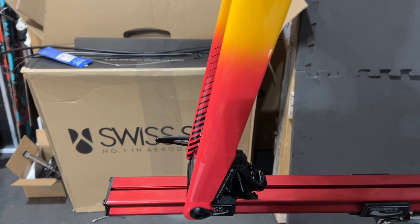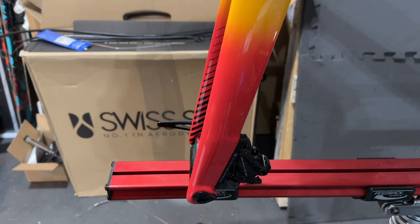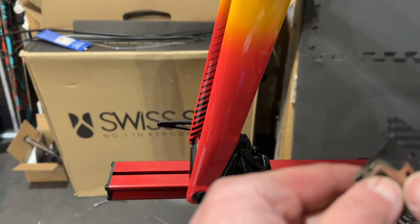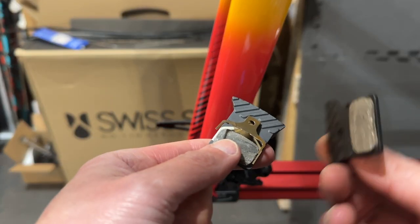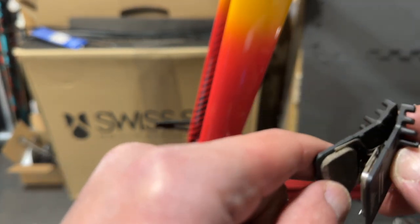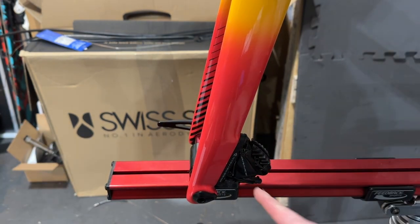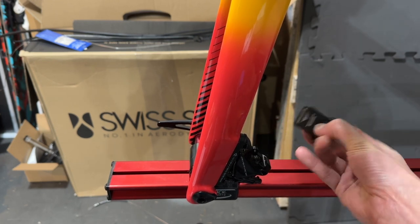So the first thing that I've done is removing the caliper, and removing the brake pads that were on the caliper, and they look something like this, right? So these are the brake pads that come with the Dura-Ace. And the way it works is it's actually pretty easy. They just essentially sandwich like this over here, right? So I just removed the locking pin, the locking screw, and there's a pin on the other side. I removed them and just slid it like this.